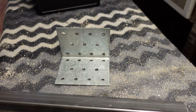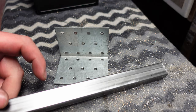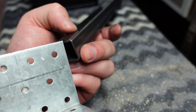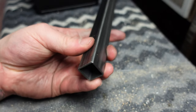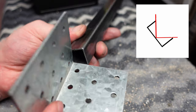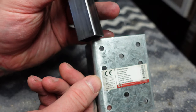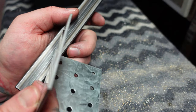And I'm not sure, but if I'm lucky, the mount on the bike is exactly 45 degrees. And if that's the case, I will be able to cut in the middle right there, and cut in the middle right there, and that way the pipe will go like that, and I will be able to put this in the middle. That way the edge on the back side here will touch the flat part, so I can drill out the hole and weld that spot as well, and weld the whole backside of this to the edge